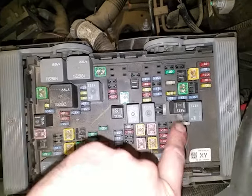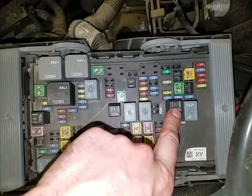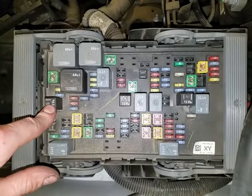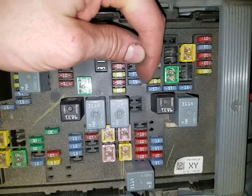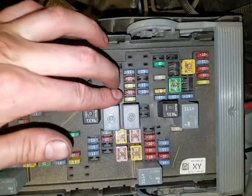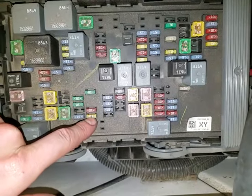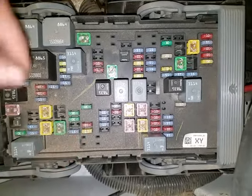As far as the fuel pump goes, this is going to be the fuel pump relay. If you suspect that your relay is bad, you can try swapping it with your air conditioning relay or your fog lamp relay there. The fuse for the fuel pump is this 20 amp fuse right there. If that fuse is blown and you need something to throw in there to get you going, I don't suggest swapping with these because these are injector fuses — throw in this fuse instead, which is for the cigarette lighter or the power outlet.